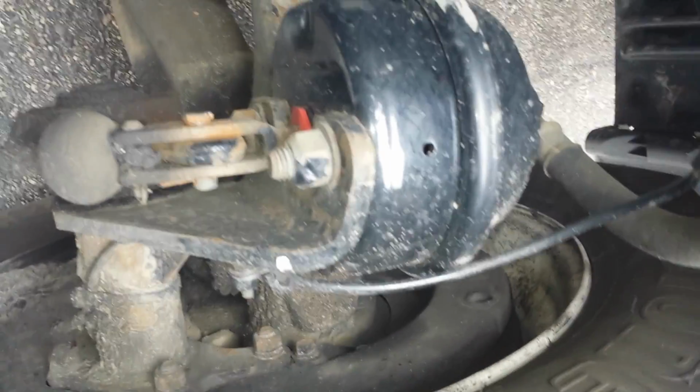Right, that's your steering column. You want to grab it, right? Not too much play in that, right? Because as I'm doing it, the arm is moving, so we don't have a lot of play in there. Right, you're looking also in here, trying to get an idea of your brakes, your cam, all that stuff.